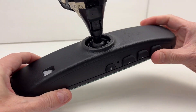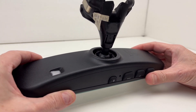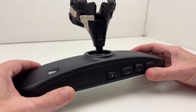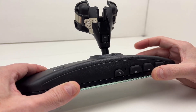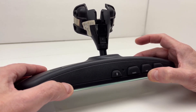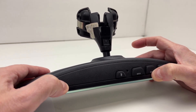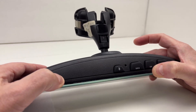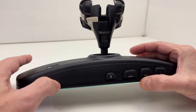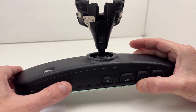Going around to the back, you can see this is a Volkswagen Mark 5 / Mark 6 bracket, designed for use in wagons with the rain sensor, the Eos, some Golfs, Passats, and multiple other Volkswagen models. This bracket is also used on some early 2014–2015 Porsches. You've got to make sure you know what bracket you need for which car you're building a mirror for. This one was built out specifically to be plug and play for my Volkswagen Eos — this is the factory Volkswagen plug, so it will plug right in to the existing wiring harness.